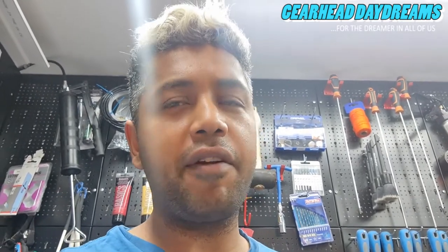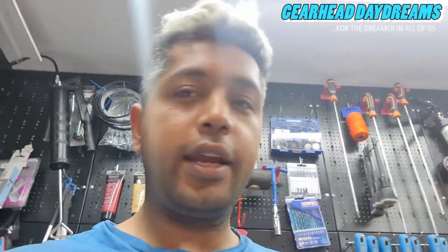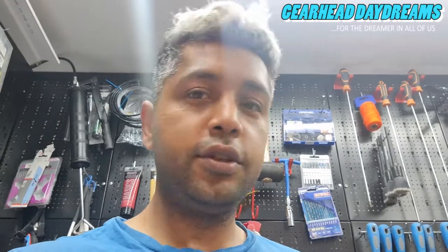So in this video, it's just again gonna be a pretty quick one. One of the limits of my capability that I've had for a while is that I am unable to rest the suspended wheel components of a car if I want to do some, say, tightening up of some end links for the sway bars, right? Your suspension has to be loaded for you to be able to make adjustments to adjustable end links, which is something I will be doing as I install the Whiteline anti-roll bars, sway bars, and then I've got the corresponding adjustable end links to go with that. But to be able to tighten those, as I've said, you have to have the suspension components loaded to get the right preload.